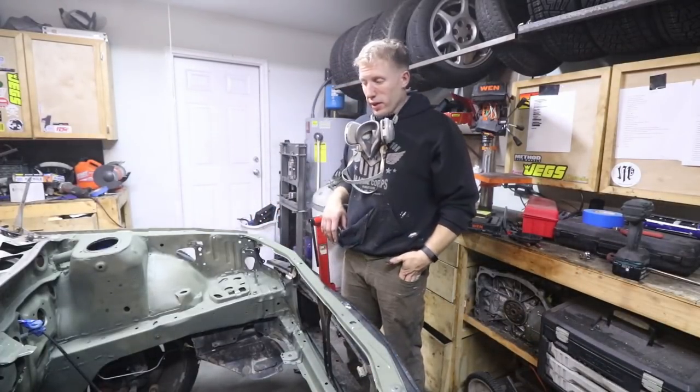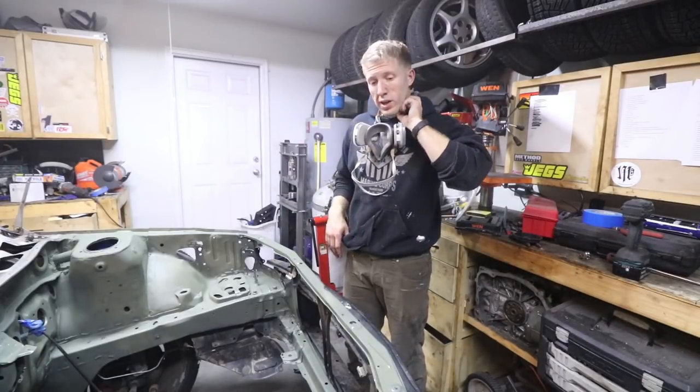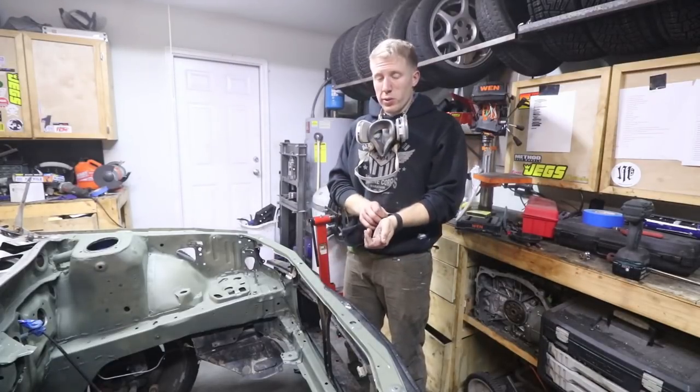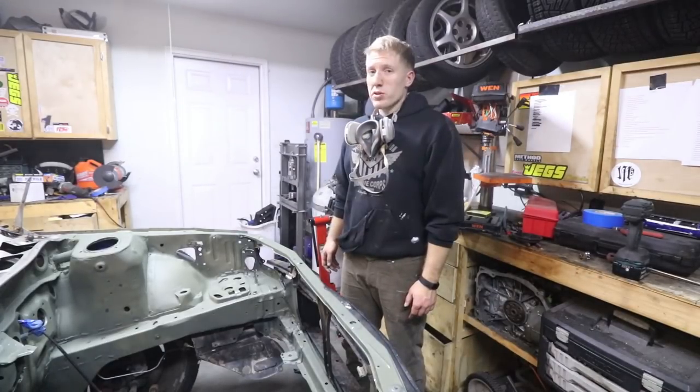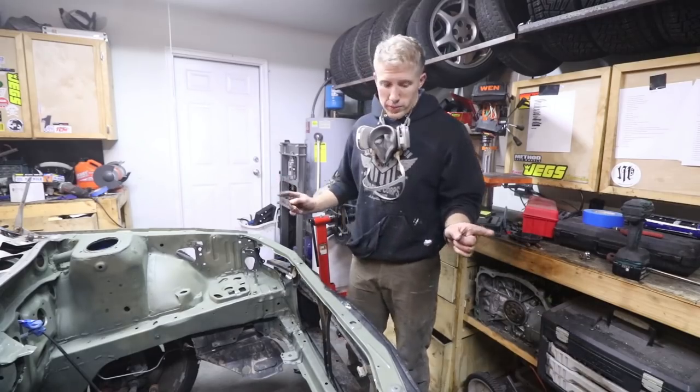That sit and flash for like 15 minutes or so before I hit it with the next coat. Not sure why the only etch primer that they had is OD green. Well, I'm gonna open up my garage door, let this air out a little bit, and come back after a few minutes and hit it with another coat.